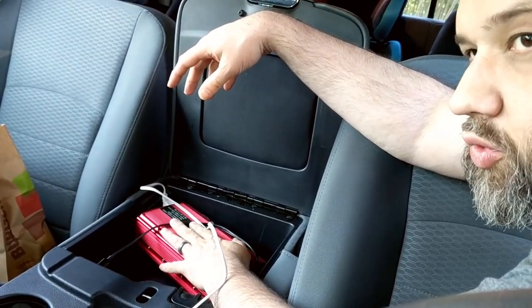The thing still stays not even warm — we haven't had any issues with it. I kind of expected it to build up heat in that closed compartment. On our road trip to Arkansas, we used it basically for 12 straight hours on the way there, never turned it off. We only had it off for maybe four or five hours before we had an emergency and had to come back — so really for almost 30 hours the inverter was working. It never overheated or got warm at all, charging everybody's stuff — laptops, tablets. For a $100 purchase, I would totally recommend it.